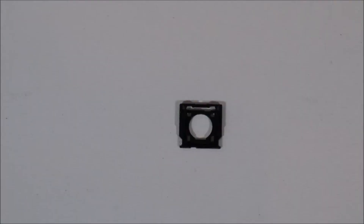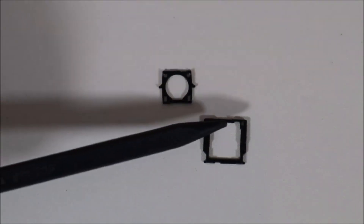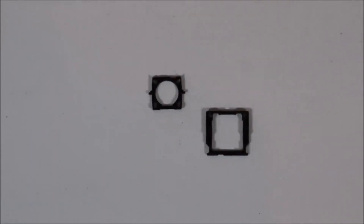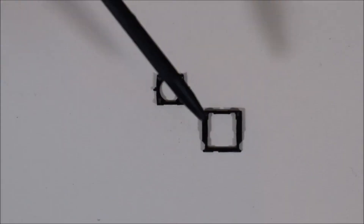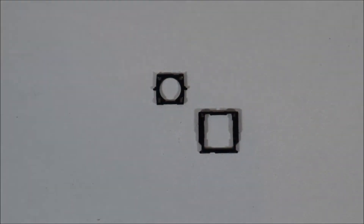Sometimes that hinge clip will come apart into two separate parts — it's a two-part clip. You didn't break it, you just have to get it back together. So there's your hinge clip or retainer clip. If it comes apart, I'll show you how to get it back together. This is the inner clip, there's the outer clip. On either side of the inner clip, you have these plastic pins and they go into corresponding plastic holes on either side. You may have to hold one end and gently pull out the other end in order to make room. Very breakable components, but you can put them back together.